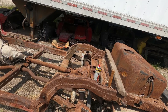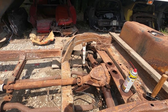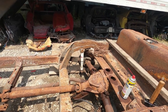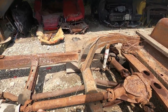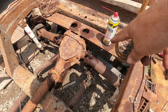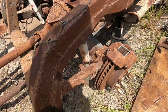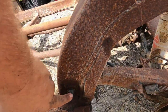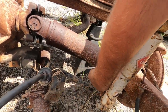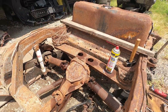These are intricate enough to warrant detailing them in individual pieces so you can see exactly how this thing is put together. It's very similar in theory to the C4 — the C4 is basically just an evolution of the C2 and C3 — where you've got a driveshaft, prop shaft here to your pinion, input/output to your half shafts, and then a control arm or spindle, considered a trailing arm, tied in three points of contact. You've got one here on the shock tower like a C4, and you've got your camber adjustment, also just like a C4.